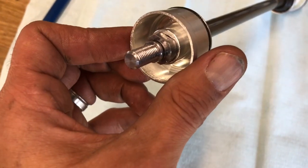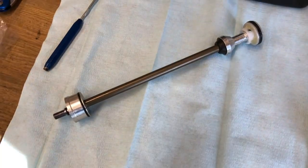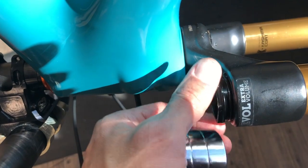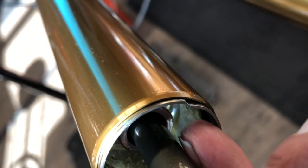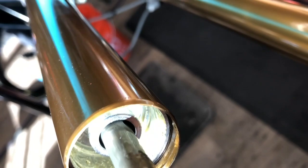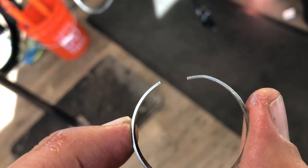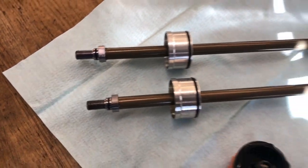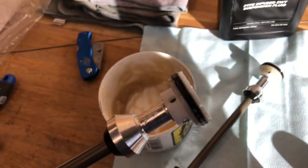This is the new 170 air shaft — that's what it looks like. Going ahead and removing the top cap that holds the valve. You can see it's got one volume spacer. Basically it's a matter of popping that little ring — there's one flat side, so get a small screwdriver or pick under it and pull it out of that groove. Once you get it out, the air shaft just comes right out. You can see how much slick honey was on that one — I think it was clogging up the little bypass gate to let the negative air easily switch over.